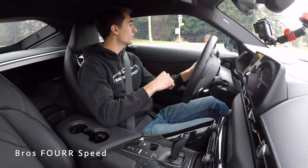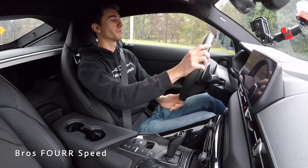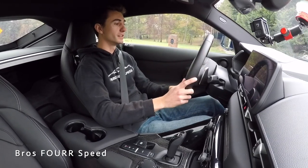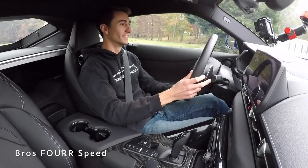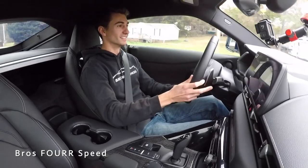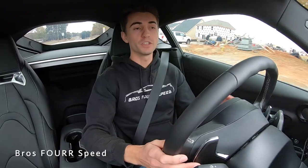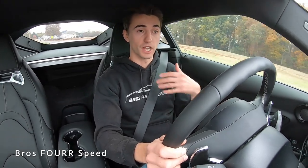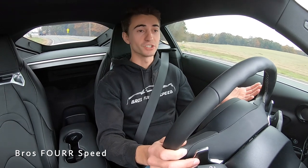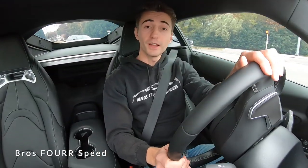The proper way to launch an automatic: keep your foot on the brake, build the revs slightly — maybe around 1,500 RPM — you can feel the car lurching a little, then let off the brake. It's 30 degrees out so my tires are spinning, but that's the right technique. You're building pressure inside the torque converter gradually so when you release the brake there's no lag engaging the transmission. It's fun to do, but don't do it every single day as it does put some stress on the car.